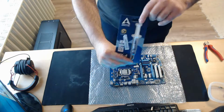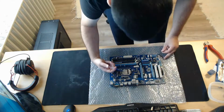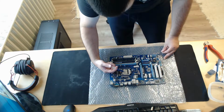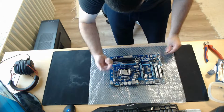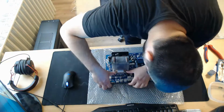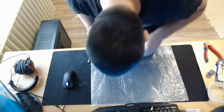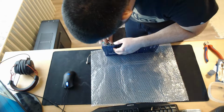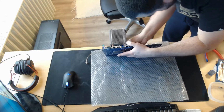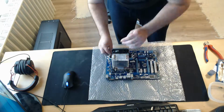Next, I will apply the thermal compound, which is the Arctic MX4. A little blob is perfectly fine, you can even see me applying a little bit too much. Next, I'm installing the CPU cooler, which I think is a Hyper 212 from Cooler Master, but I'm not entirely sure. If you know which one it is, please leave a comment down below. Plug in the fan and voila!